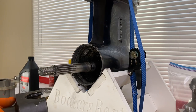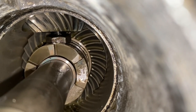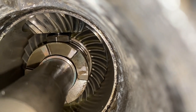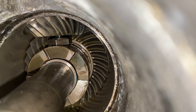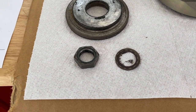Back inside, and as I rotate the propeller shaft and the clutch dog, the pinion gear nut is completely removed from the drive shaft's thread. I'll basically have to maneuver the propeller shaft to give me the clearance to pull that nut out, and also pull up on the drive shaft above. Back to the workbench — there it is, the pinion gear nut. It had a washer placed in between the nut and pinion gear itself.